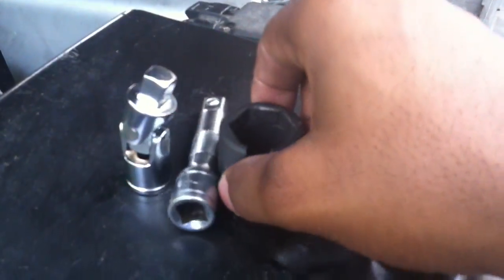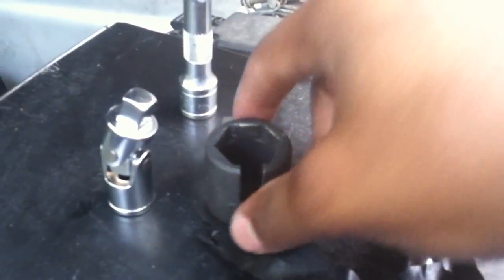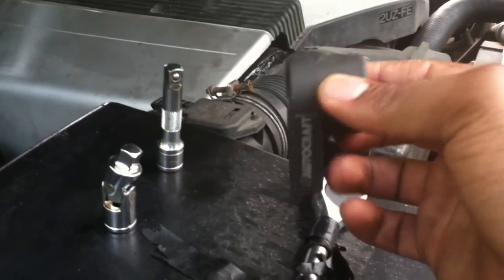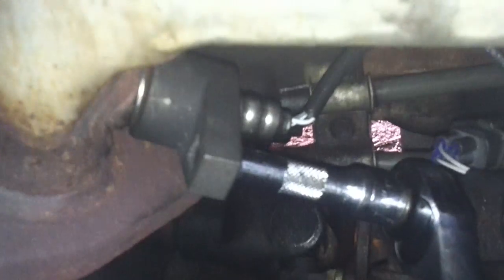That's the clip that needs to be unclipped. The tool needed for replacing your O2 sensor — you're going to need to purchase a three-eighths O2 sensor socket. Here's the easy setup with some electrical tape on for grip, with the extension and O2 sensor socket attached.